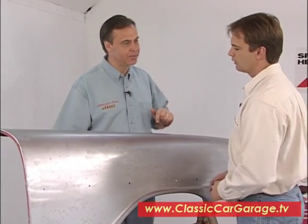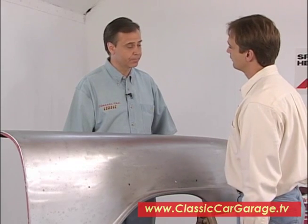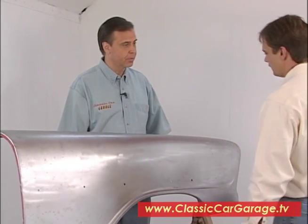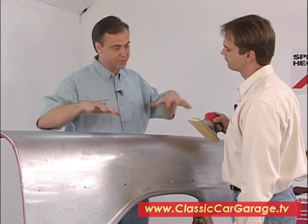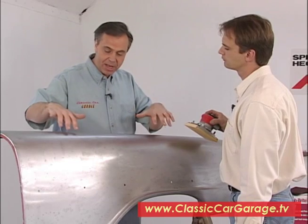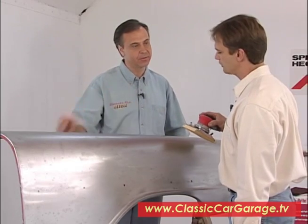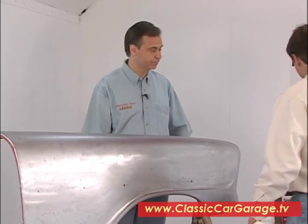We've got our fender up here. We welded up a few holes, did a little body work and metal shaping in the front where the car had been tapped. We had to remove a lot of residue left on here from the chemical stripper. We used a dual-action sander with 80-grit sandpaper first — that's nice and coarse — then went to 150 grit. But because we've touched it with our fingers, that leaves oils in here, and we need to clean all that off.